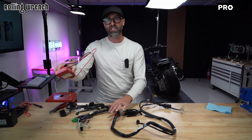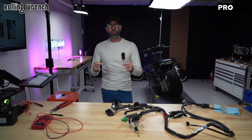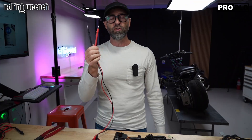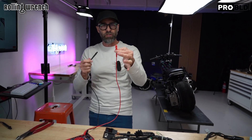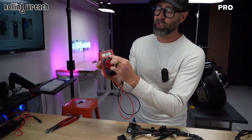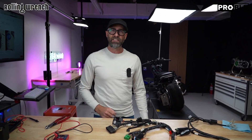There's more you can do with an ohm test than just that. There's resistance readings for measuring ignition coils, any electrical components — they'll all have a spec within the service manual, so you can use this to look up resistance readings in your manual. Say if you think your ignition coil is bad, you'll test this on this wire, this on this wire, and it'll come up with a specific number within the range, and then you'll know if it's good or not. That's getting pretty technical — I just wanted to make this video the simple stuff. Let's move on to AC volts.